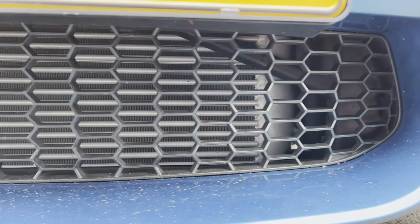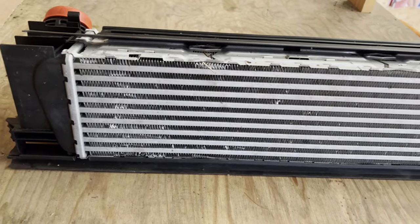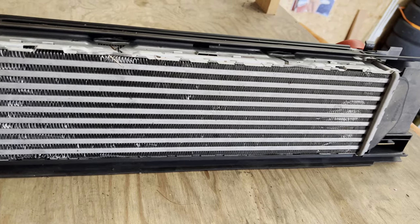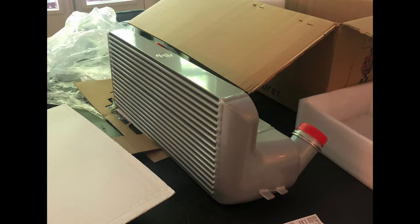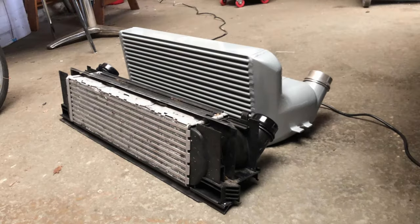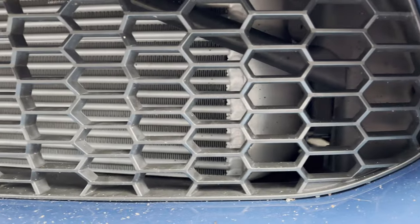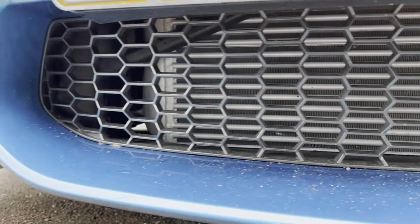The final upgrade under the hood is the intercooler — another upgrade a lot of M2 owners do. The stock intercooler really underperforms in the M2; it's too small and makes the car suffer from heat soaking when really pushing the car. I replaced mine with the CSF intercooler, an aluminium bar-and-plate intercooler. Although being a bit heavy, the quality and looks are great. The screws and washers that come with the kit, however, are extremely bad — I don't understand how CSF can make such a good intercooler and then supply it with very flimsy screws and way too small washers. It's also a shame they still haven't addressed this issue over the years. Anyway, I did a video on the intercooler when I had around 70,000 subscribers, so go check that out if you're interested.